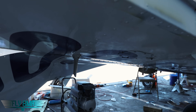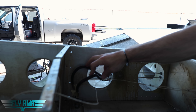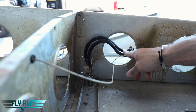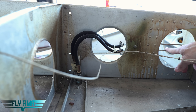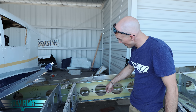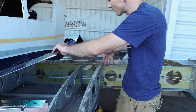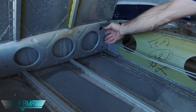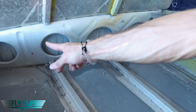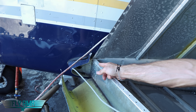Coming up here, what it looks like inside the wing: we can see two tubes coming off of that pitot vane. One is pitot, one is static — back one's static, front one's pitot. They transition from the steel-reinforced rubber hose to aluminum lines here, coming along our main spar, following right through where our fuel tank used to be. They fall along the main spar going inboard, V off behind this rib, and then eventually go into the fuselage and into the cockpit right through where the forward wing attach point is.